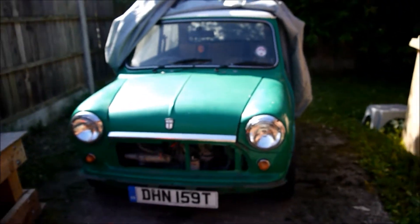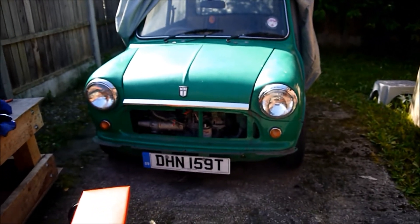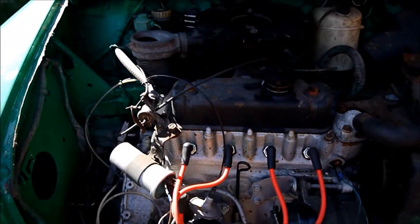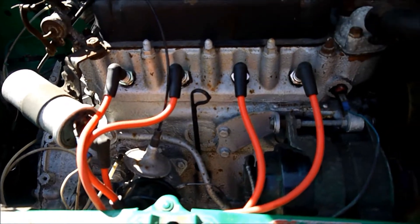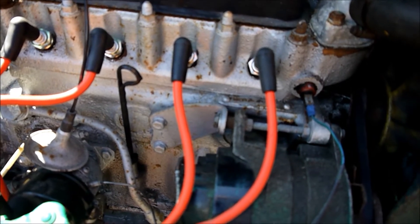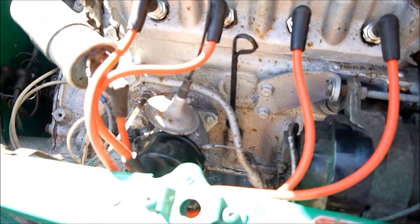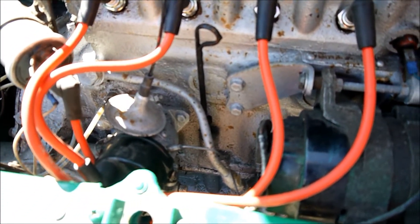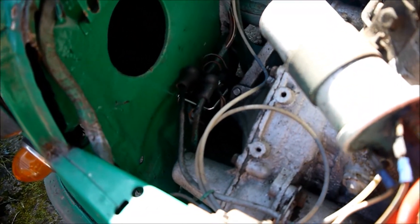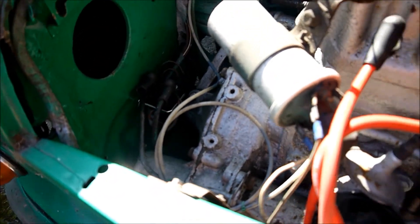Here's the Mini. We actually did do a little bit of work on it today — Gilly ended up coming round after all. We put in new spark plugs, new cables, and we're going to put new points in. We also got a new distributor cap and new rotor arm, but the rotor arm's the wrong one, and the new air filter seems to be the wrong one too so we'll have to send that back. We also put the new solenoid on and luckily it fired straight up — before that we had to short it out to get it to fire.